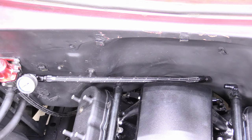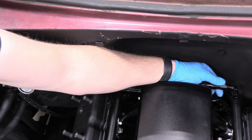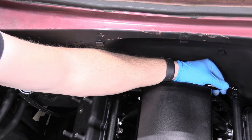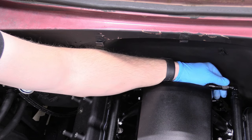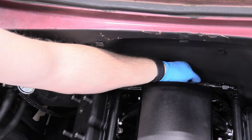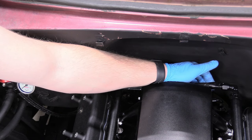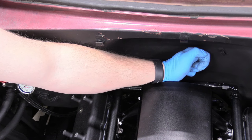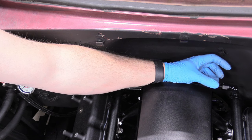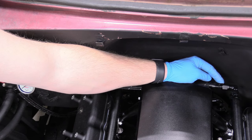I'm going to leave the fuel rail end of the feed line finger tight for now — just so nothing gets into the fuel system. The reason I'm not fully tightening it is so I can remove it by hand later, put this end into a cup or bucket, turn the system on, pump fuel through, and any contaminants in the fuel line, filter, or fittings will end up in the cup rather than in our fuel injectors. So we're going to leave that loose for just right this moment.